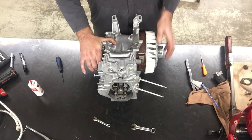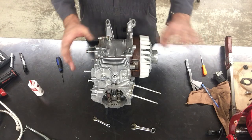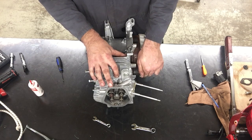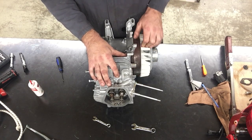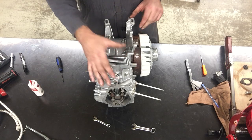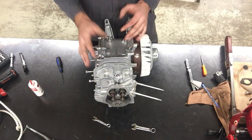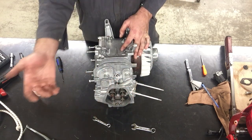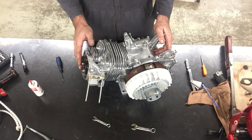So you learned your lesson. Now I'm going to confirm that my engine has compression before I go much farther. Normally I'd have my recoil on and could pull hard, but I'm going to plug the spark plug hole with my finger. I pulled and created a lot of pressure — what that means is both my valves are closing. As long as they're not too loose, I won't make any noise. If I start this engine and find the upper end is a little ticky or clattery, I might have to pop the valve cover off and do it again. But for now, that valve clearance is set — that was one of the big steps on this engine. Hopefully you'll document that really well.